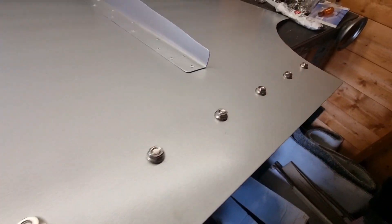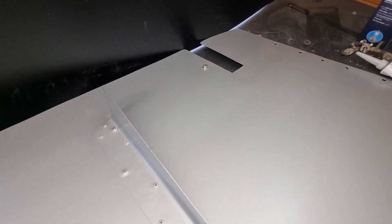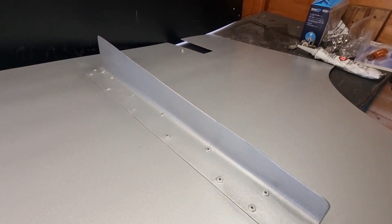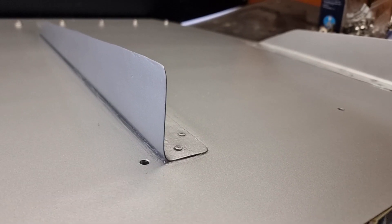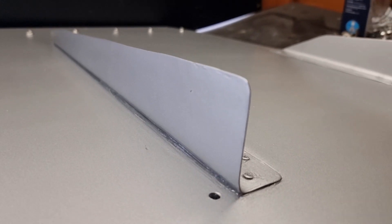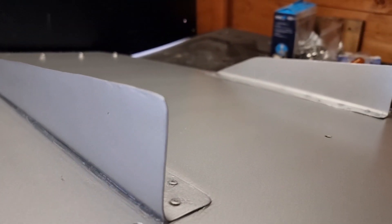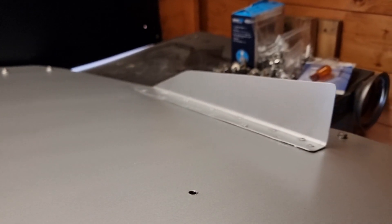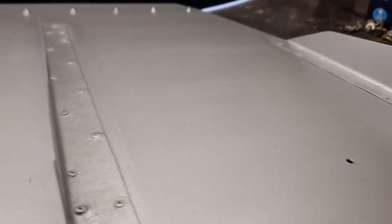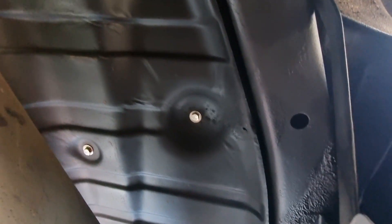The brackets are bolted on — just got to do the two in the middle which bolt to the car itself, and then I'll be ready to refit on the car. The silicone has now been applied — just let that dry and then I can fit it. In the meantime I'll fit the heat shield back over the back box, get the smaller panel fitted on the other side of the exhaust, and get that built up. I've now got the heat shield back on with some stainless hardware and the smaller piece the other side of the exhaust is now done.